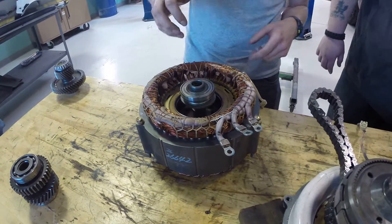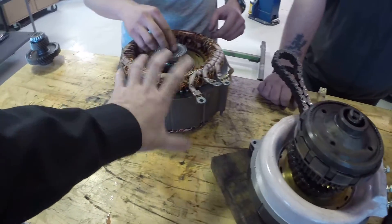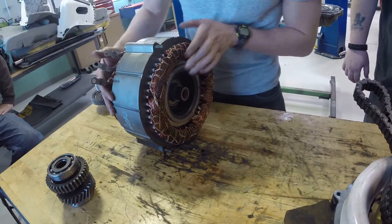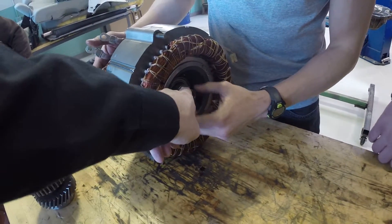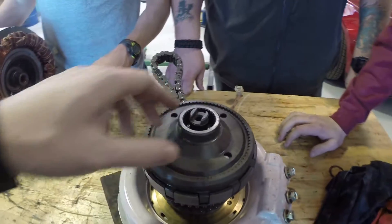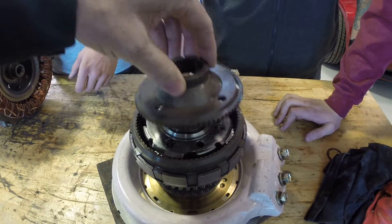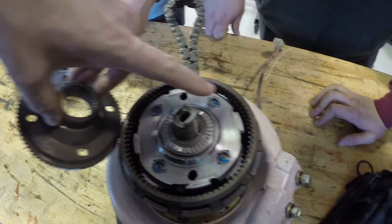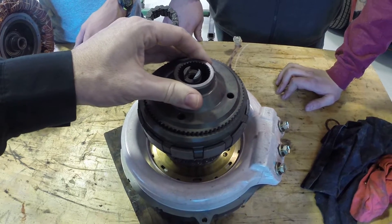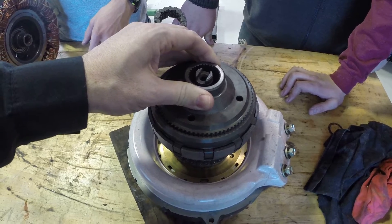Yeah, that thing is sharp too. Okay, now stand this up on its side. You can see the splines here on our rotor for MG2 fit into the splines here — essentially what is this attached to? We've got this little plate here. Yeah, that's attached to your ring gear, because you can see here are your planets right there — little tiny teeth — and there are lots of them. They're really strong.